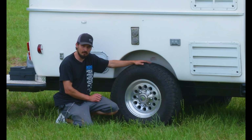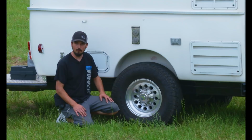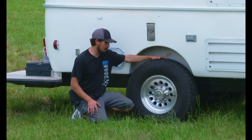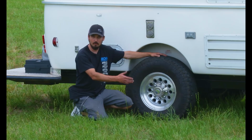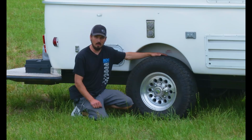And that's really important. When you get off road, you're in these off camber situations, or you're going across the desert and it's rough, you don't want to open the door at the end of the day when you get to where you're going and all of a sudden your cargo's laying everywhere. So we've accomplished a soft ride, but also upgraded to bearings that we're not going to have to worry about, and brakes that could stop the truck, let alone itself. The brake size has been upgraded from a 10-inch brake to a 12-inch drum brake. We stayed with electric brakes, very simple. These parts are available off the shelf at any supplier that carries trailer parts.